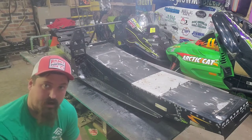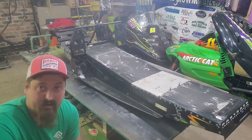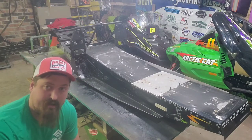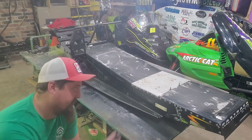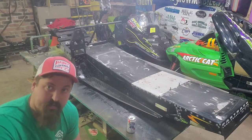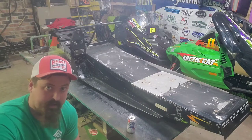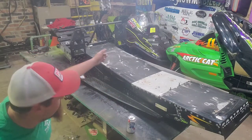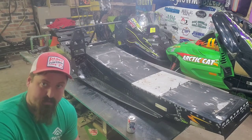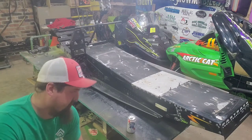When I set out to do this, I didn't want an overlapping seam — I don't think it looks clean. I wanted to try to make it as factory as I could. I use large-head rivets from Ace Hardware. They have a snowmobile logo on them — stainless steel with a large head, 3/16ths. They've worked great. I used them on the oval sled and they worked awesome. So I figured if they worked on a sled going around a track, they should work on this project pretty easily.